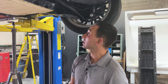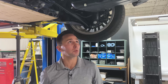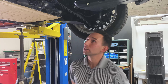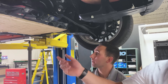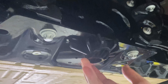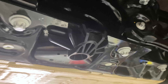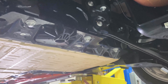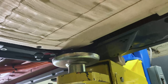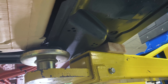In typical German or European format, they're using largely triple square fasteners versus just a regular hex head. BMW and many of the German OEMs use these plastic points for lifting points. There's a rear lifting point at rear center. We couldn't get our jack head to mount on them — it's under this piece of wood — but there's a rectangular plastic lift point. It's really convenient on a German car where you always know where to jack versus picking the right spot on the flange.